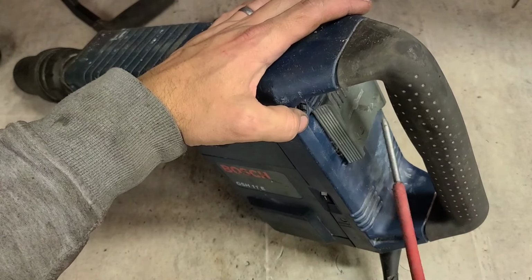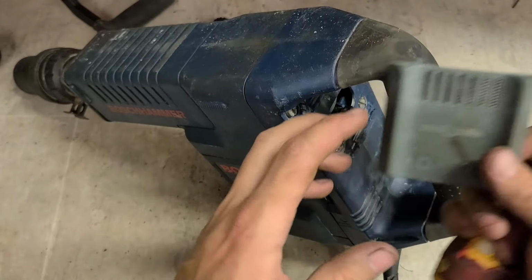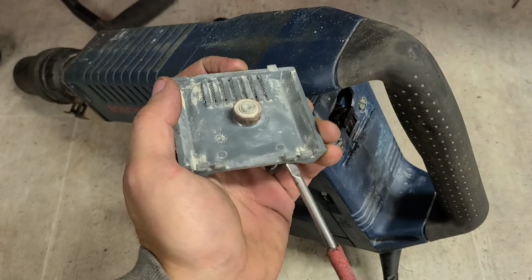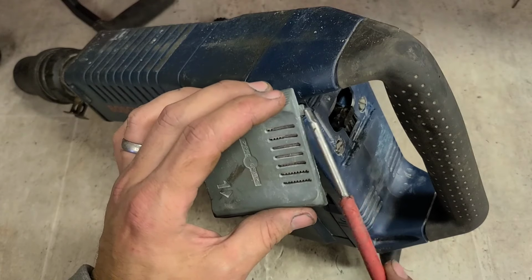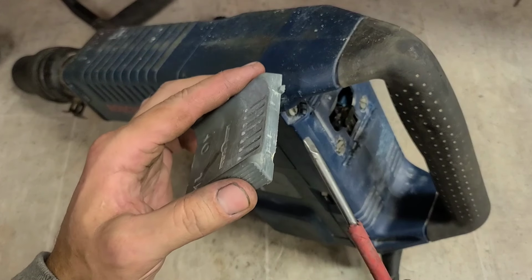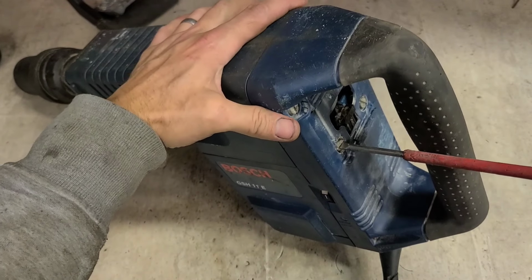So always when you're taking off this here wee slide switch, prise it up from the bottom. The bottom pushes on, top, there's two wee keyways. So these actually have to slide in. As you can see, somebody's already broken that one off.